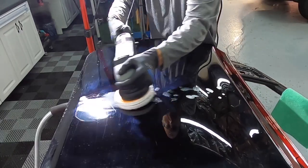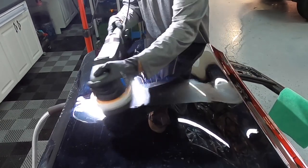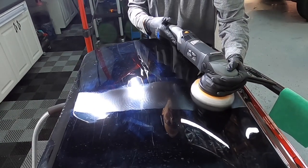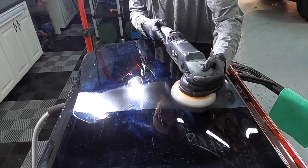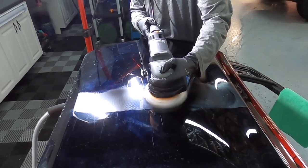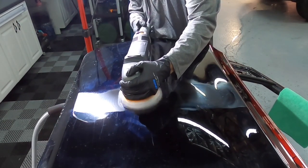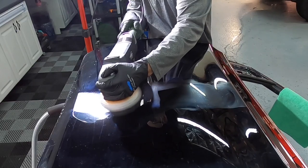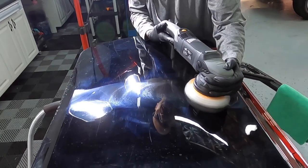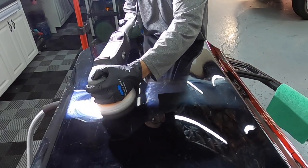Let's get back to water-based clear coat. Back in the day, when there weren't heavy regulations, polyurethane paints were very popular but they were dependent on solvents to get from the can to the panel, and about 75% of those solvents would evaporate into the air. EPA standards now cut that back to 50%, so companies are switching over to water-based clears, which are acrylic paints. They need just water to adhere from the can, and the only drawback is cure time — it takes a lot more time for the clear to cure than if it were a polyurethane with solvents as the base.